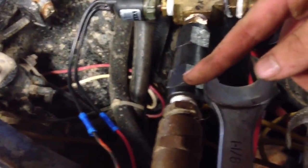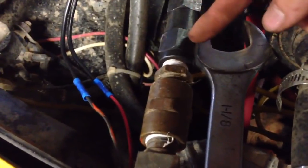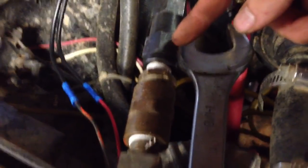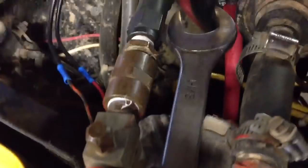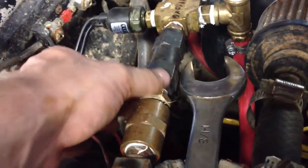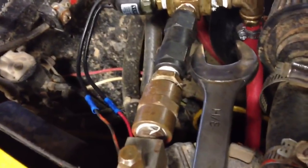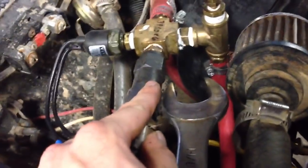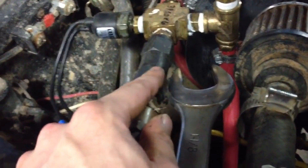And you'll notice there's no unloader valve. Normally that would go on this side of the check valve. Once the system builds up to pressure and the pressure switch turns off, it flips another little lever which opens up a small port right here on this check valve, which depressurizes this, so the compressor can start up easier and you don't have head pressure. I used to run that, but I did away with mine, so I hope that's not going to cause any problems for me.